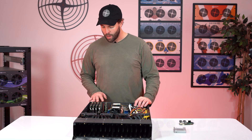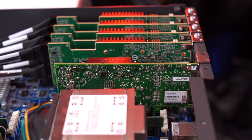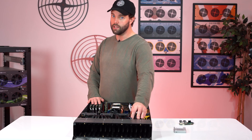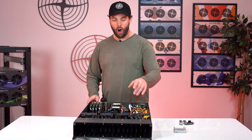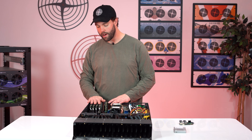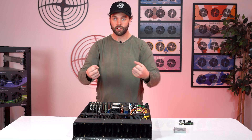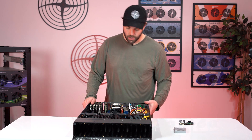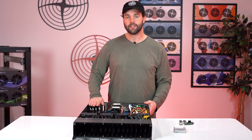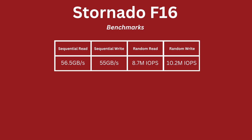There are plenty of PCIe lanes on all the boards for high-speed networking. We're talking tens of gigabytes per second — 60, 70 gigabytes a second. We're getting all four PCIe lanes out of these drives with the same direct-wired architecture and HBA cards, maximizing parallel access. We need a lot of high-speed networking to get data out of the box, so we've got the LSI 9600 cards and millions upon tens of millions of IOPS per second out of these things. Lots of IO power, and less electrical power because we've got fewer drives.